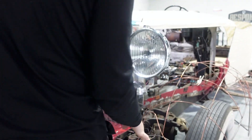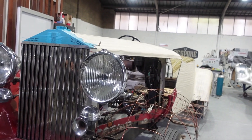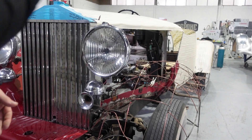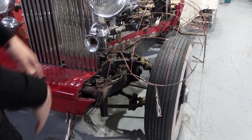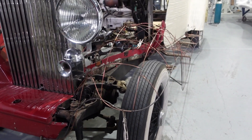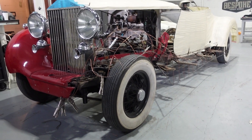On the front, this is what I was talking about earlier where the owner wanted a real sort of cutaway shape like the early twenties Phantom II and Phantom I cars. It's a little bit of a design challenge actually, because the Phantom IIs and Phantom Is were an I-beam front end — the chassis was a completely different construction. So I've tried to add that element of the earlier cars into the later model where the chassis is different. We're trying to cover up as much of the inner workings as we can but still giving that high cutaway. It's a little bit of a tough challenge trying to fill in all these empty spaces, but overall I'm quite happy with how it's all come together. I think it's extremely unique and it's going to be a fun one.